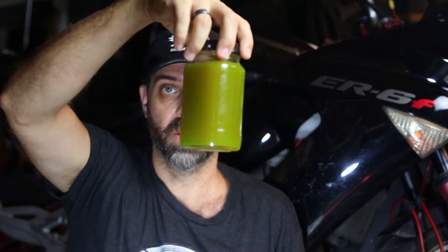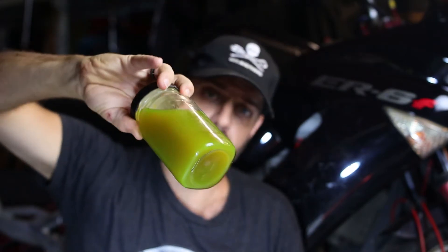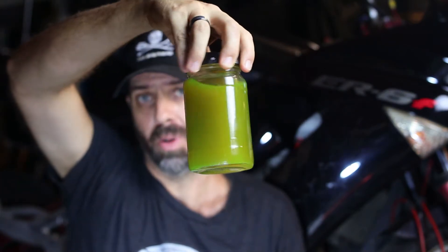I'm doing the mechanical oil seal and an oil change on the bike — definitely due. We're coming into summer, she's starting to run a little bit hot, and I noticed that when I dropped the coolant, it was a rather strange colour. It made me think about when the last time I actually changed the coolant was, and I'm estimating it was approximately three or four years ago. This is what coolant that's getting old is going to look like — we're getting potentially a little bit of corrosion, and the coolant itself is starting to break down.